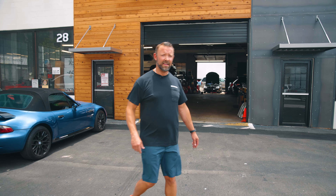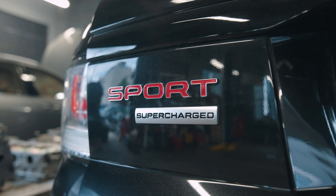What we're going to go over on this vehicle is that the Jaguars and the Range Rovers on these platforms don't have coolant lights, they don't have a coolant gauge, they don't have a temp gauge. Basically, it has a low coolant light that tells you to get off the road because the car is overheating. Other platforms like BMWs and Mercedes will actually shut the car off when the temperature gets too hot, so it'll save the engine. On these particular platforms, it runs until the motor basically stops running and does damage, just like it did on this one.